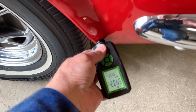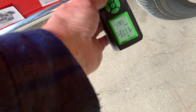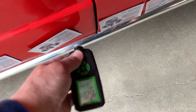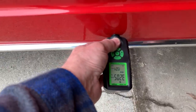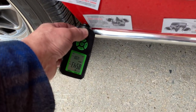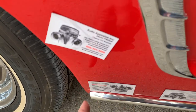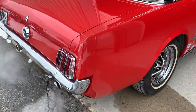Digital meter-wise we've got really good low readings: 5.4, 6, down here where I have magnets — 4, 4. The corner of this door has had some repair — high readings of 21, 33, 9, so it's a very small repair just in this little section. Adhesion is good otherwise. Through the bottom of the door: 3.2. Back here in the corner of the quarter: 8. There's one area with a little repair, a small bubble. The other door has better adhesion in the corners than this one.